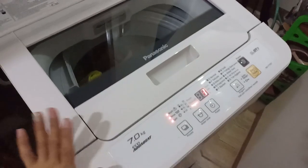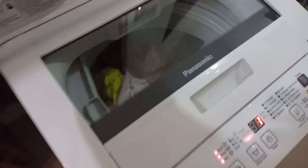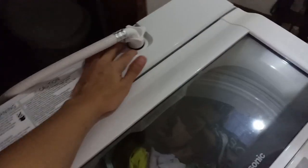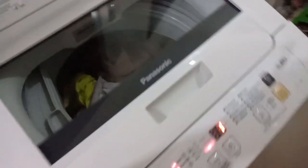Here's another tip so you won't be surprised — even with the machine off and the faucet open, water won't come out here because this port is closed automatically. We thought there was something wrong at first because we opened the faucet and no water came out. Even after removing the cover it still wouldn't flow. We realized you need to click Start first before this port opens. Let me open the faucet — you'll notice the water doesn't flow directly yet.